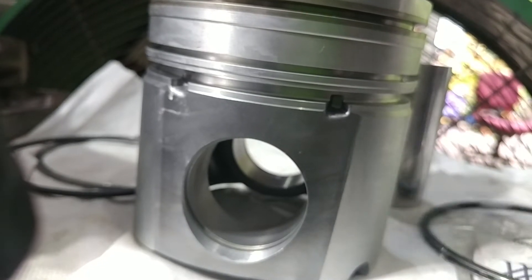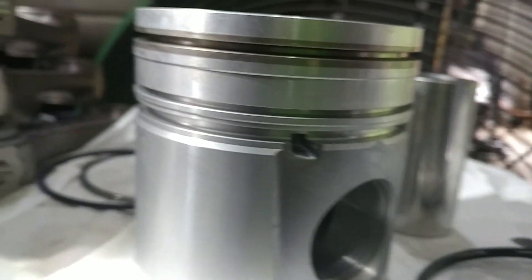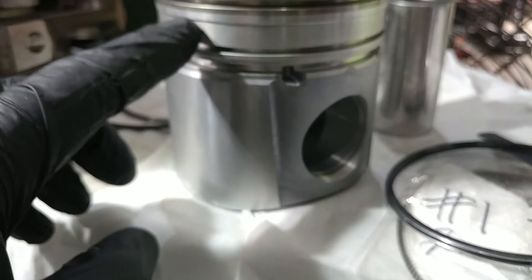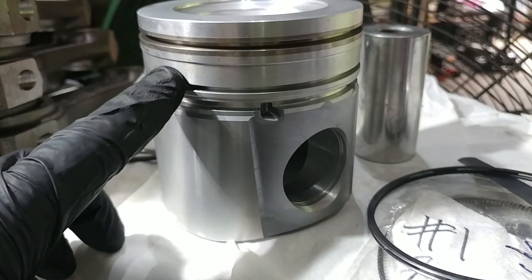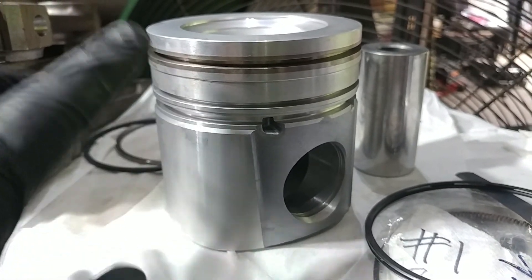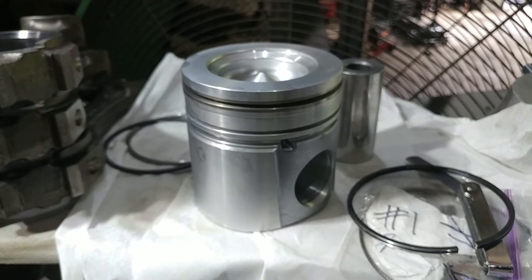What we do is rotate the piston and check it in another spot. I've already checked all of this on cylinder number one, going through the board. The intermediate ring is consistent across the board, and so is the oil control. The oil control is tighter than four thousandths, and the intermediate is right at about four thousandths. The specs are: intermediate ring maximum six thousandths, oil control maximum five thousandths — without binding. All right, we'll catch you on the next video.